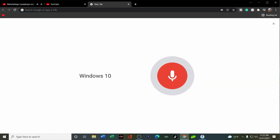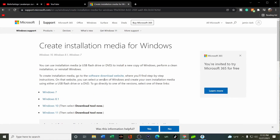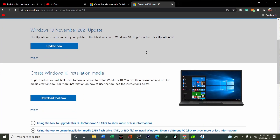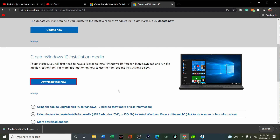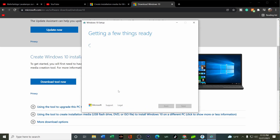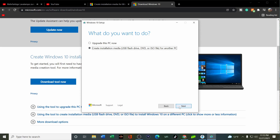Now, if you need to make a bootable USB with Windows 10 or 11 on it, this is how you'll do it. Just Google 'Windows Media Creation Tool' and click to download it. I should mention that if you don't have another computer, you should do this before taking your old hard drive out if possible.